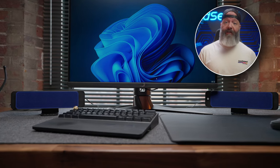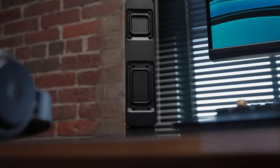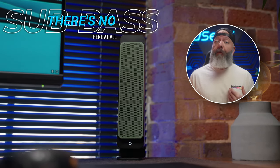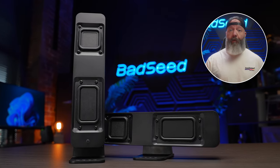Talking sound quality, my impression of these varies a lot by genre. They're going to do way better with tracks that require a little bit of bass warmth, not a lot of deep bass to sell the experience. They are very detailed and can be pretty unforgiving to a rough mix. There's solid separation and detail in the mids and highs, and all the vocalists — male and female — sound true and accurate. I don't think it's fair to say there's no bass. You do get some warmth and a decent fill from the low mids, and they just start to rub the top of that bass frequency range right at around that 60 to 70 Hz mark. You're not going to get any bass punch or slam, or those low, round, tonal notes. There's no sub-bass here at all, but I wouldn't expect any of that out of a desktop micro monitor system like this. In the mids and highs, I never really hear them struggle — even at high volumes, it's only when they're trying to get low that I pick up on some distortion. I like these better in their vertical orientation because you get a pretty convincing tall wall of sound effect. When they're horizontal, it sounds wider instead of taller for obvious reasons. They do have solid off-axis performance, but the best experience is still having them pointed at you sitting in the sound field.